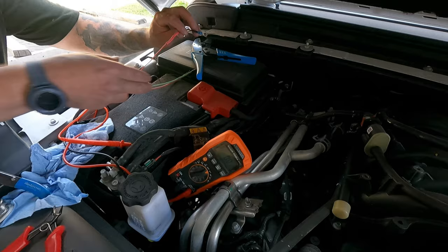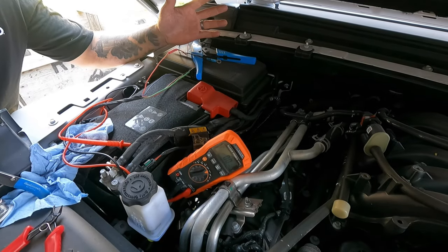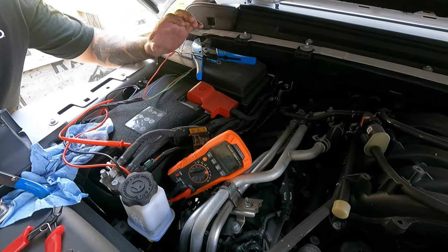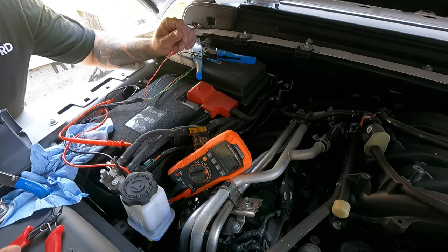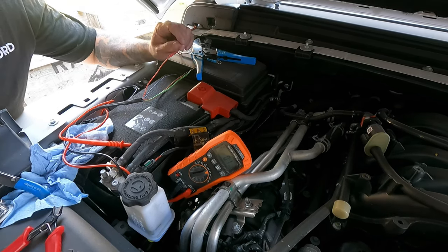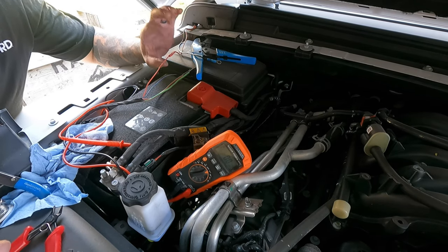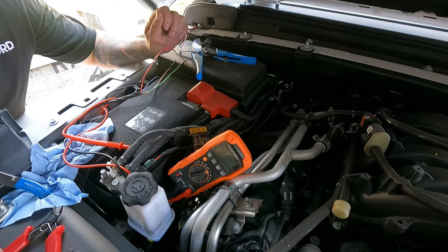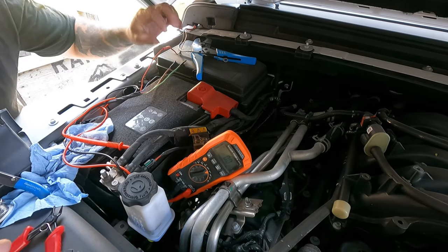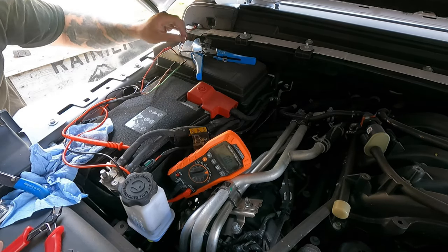There. So now, I know some of you probably say, why not put tape in there? You know, everyone says heat shrink, tape, solder. It's adhesive lined heat shrink, so there's glue the whole way through it. That's going to be more watertight than if I just taped it. You put some heat shrink on there, away we go.